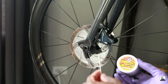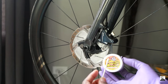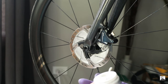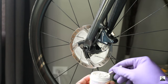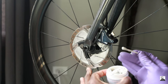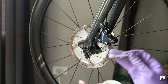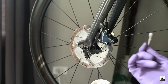Let's go ahead and get this Squeal Out on our rotors and pads. The directions say to mix up the paste a little bit before applying, and it recommends using gloves — safety first. If you really want to be a stickler for maintenance, you could wipe down the rotors and pads beforehand using isopropyl alcohol or sanding paper.